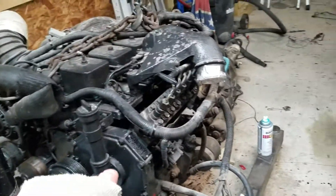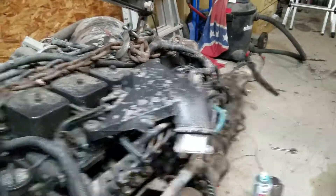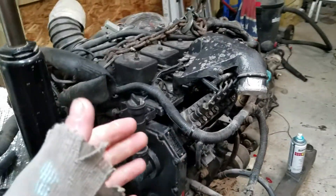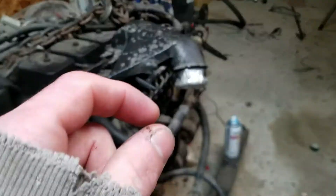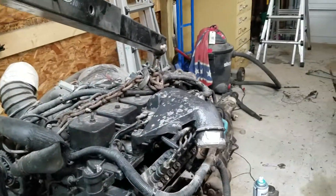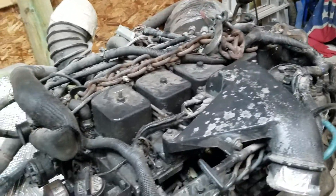Also, I will touch and say that the international block — if you do by chance have an international block and you find out you do — you definitely want to make sure that you keep up on the coolant. Don't mistake it for the 53 block, but the international block, because international did make one. On the international block, the coolant passages are a little bit thinner than the Cummins the Dodge made. So you pretty much just want to make sure you keep the temperature down. It allows the pressure to stay lower in the water jacket, so it doesn't crack in there and you don't see water in your oil.